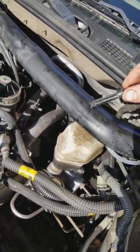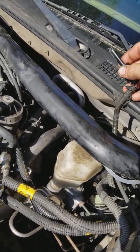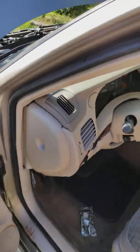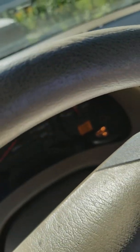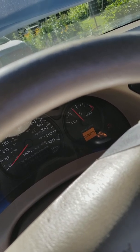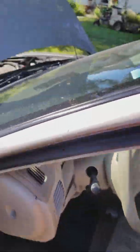You pull the sensor out by pushing the two prongs from the other side with a little screwdriver or some snips. When I do that, my brake warning lights go out — both of them are off, no more flashing. But in my case, simply replacing that sensor won't make it go away.